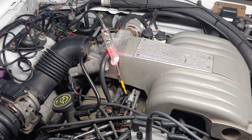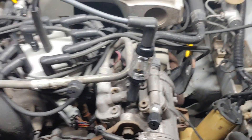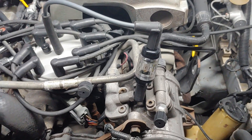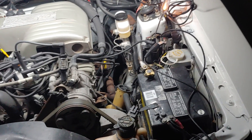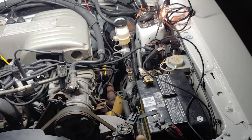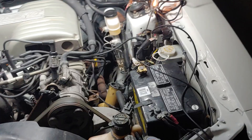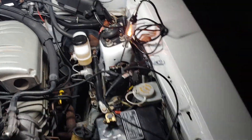So you're gonna need some really expensive tools - a $12 test light from Amazon, an $8 LED test light from Amazon. You don't need this, but I'm using a pretty nice Matco starter bumper, and then an inline spark tester, which is probably ten bucks. So you spend twenty to thirty bucks on a couple of decent tools - they're not name-brand but they work fine. This is all you need to do a whole bunch of tests on your 5-liter. They call this little incandescent test light a 'scope on a rope' for a reason.